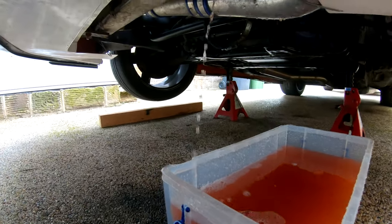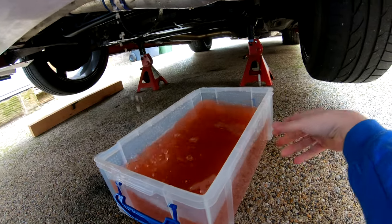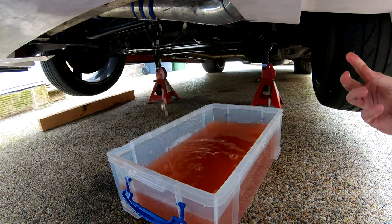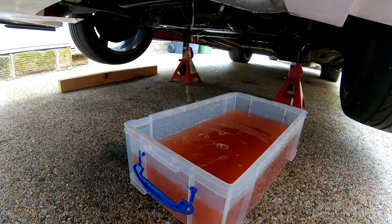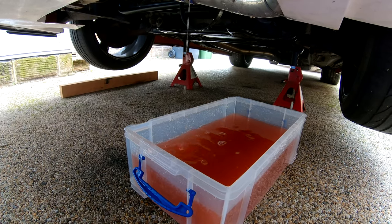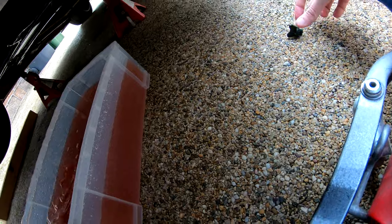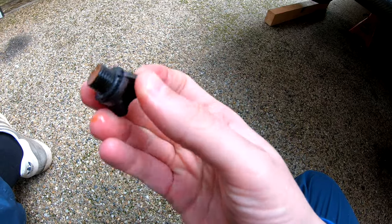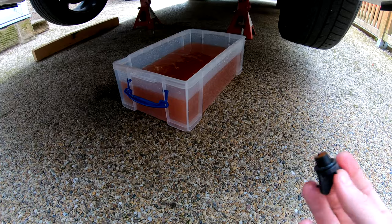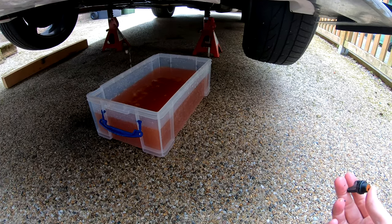At the moment we're still draining. I took the cap off the radiator after a little while and that helped the rest of the water just fly out — created a vacuum, sucked in air, and out it came. I'm going to leave the drain bung out as well because that rubber O-ring seal is very cracked and worn — I'll replace it for a new one and put it on the bench. I'll make sure I stick it back in before topping back up.